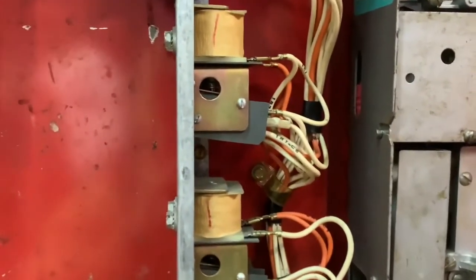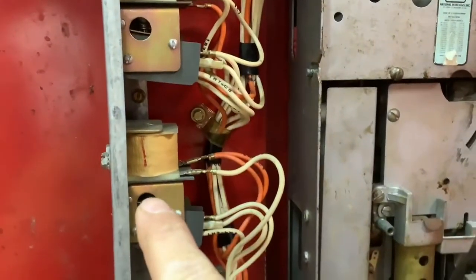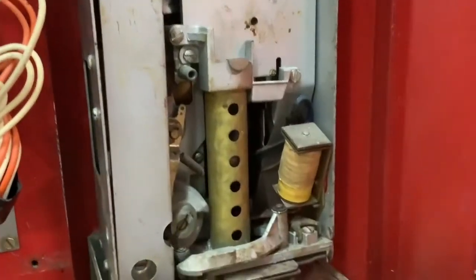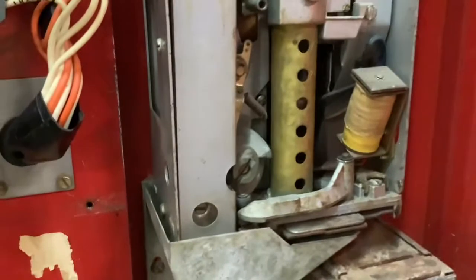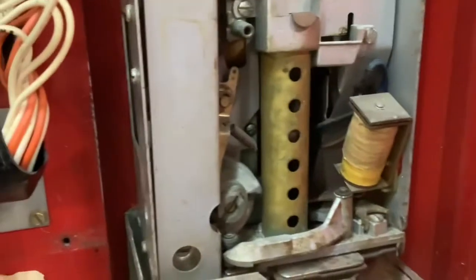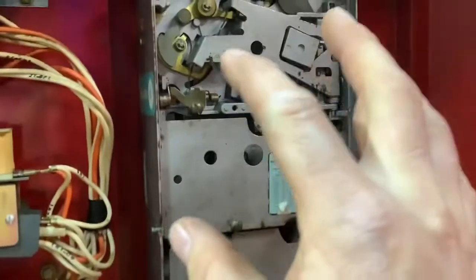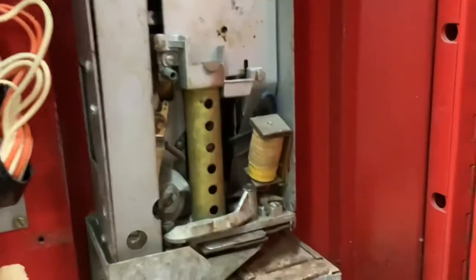Things happen, and normally that's when these solenoids, it's been where like this top one clicks, and then if I push a vend button, then that one clicks, and then the drink comes out. But I can't get it to duplicate anything, and I have no rhyme or reason of how and why. That motor is not sounding great, so I think I'm going to take this back apart and see if I can get into some of these guts and keep working on solving this issue.